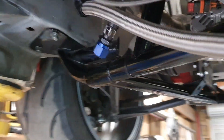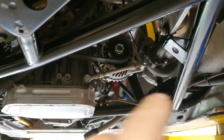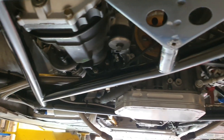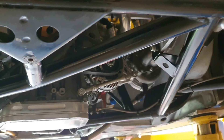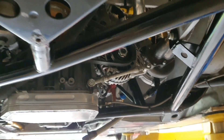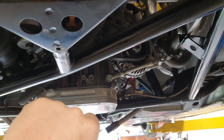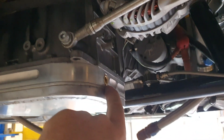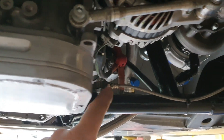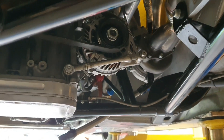The other thing that needs to be improved is the draining system for the turbos. You can see the turbo drain and the sump — these are quite low and quite close together, but they're also quite a long way out, and that's probably a bigger problem than the vertical height. Because of cornering forces, oil in the sump going at over 1G on corners is going to want to go sideways, and right there is the drain fitting for the turbocharger with a nice big AN10 hose going up to the turbo — so the oil is going to go up that hose and try to flood the turbo core.